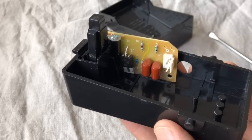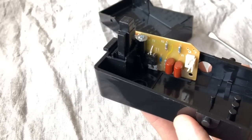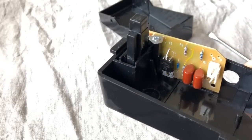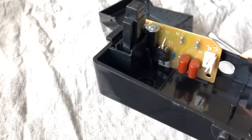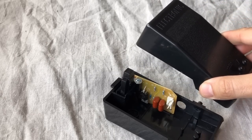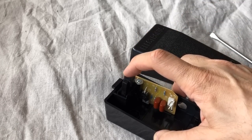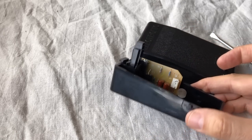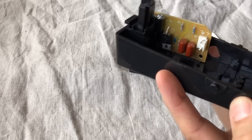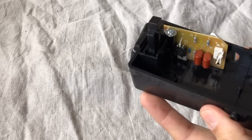This is a great example of how things started to get smaller. Inside you can see capacitors, transistors, and a small circuit board — that's part of the reason this pedal doesn't weigh very much. All of that circuitry controls and manages the flow of electricity into your sewing machine as you press the pedal. The top section has its own little button that presses down to regulate power.